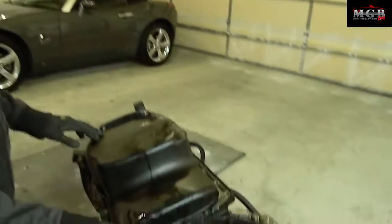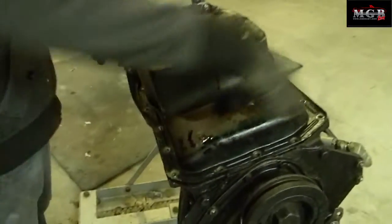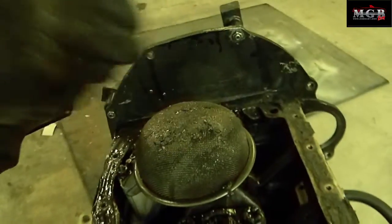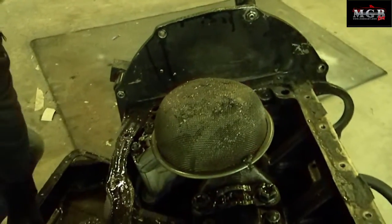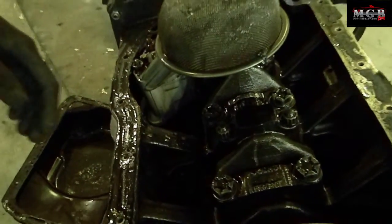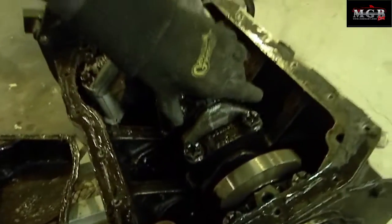The first thing you have to do is take off your oil pan. There are many nuts that go around the entire thing. If you see all this shrapnel overrunning your engine — you've got it everywhere — that means you've chewed up a bearing, and that's just under these caps right here.